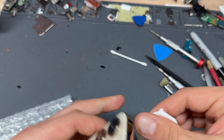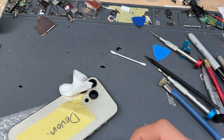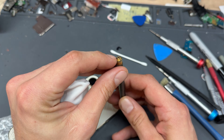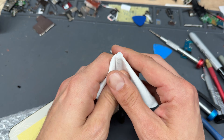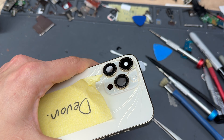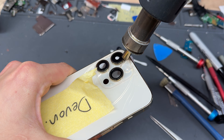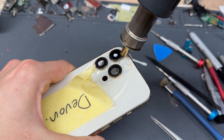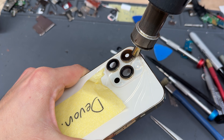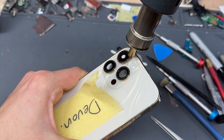The only way you can ensure these are genuine sapphire crystal camera lenses is if you take one from an existing phone — a genuine housing that hasn't been tampered with before. The best way to do it: use one of these with a perfectly shaped pointy end, stick that over the end of it, rest the housing on the lens you want to take off, then crank up the heat on the heat gun and blow some hot air at it until it's warm enough to just pop off. It's a bit awkward and difficult to remove, but eventually the camera lens should come off without cracking. I must admit I have cracked a couple of lenses like this and sometimes they ping off into the stratosphere.